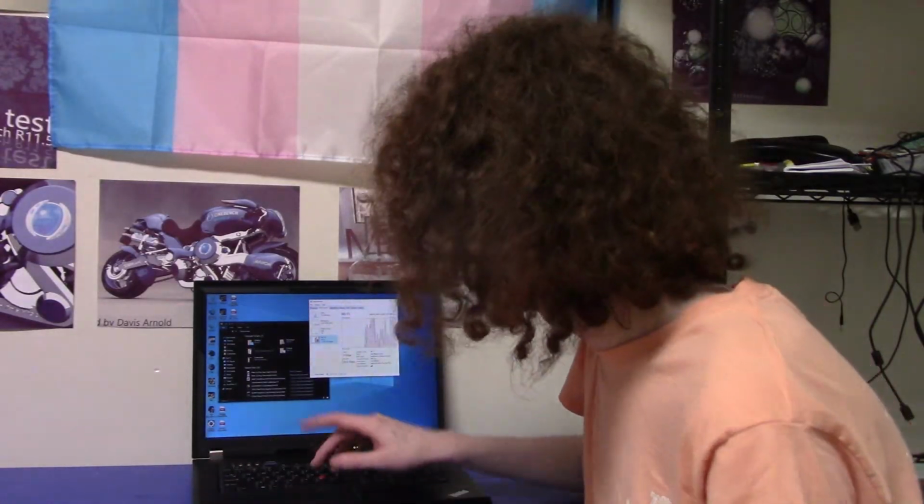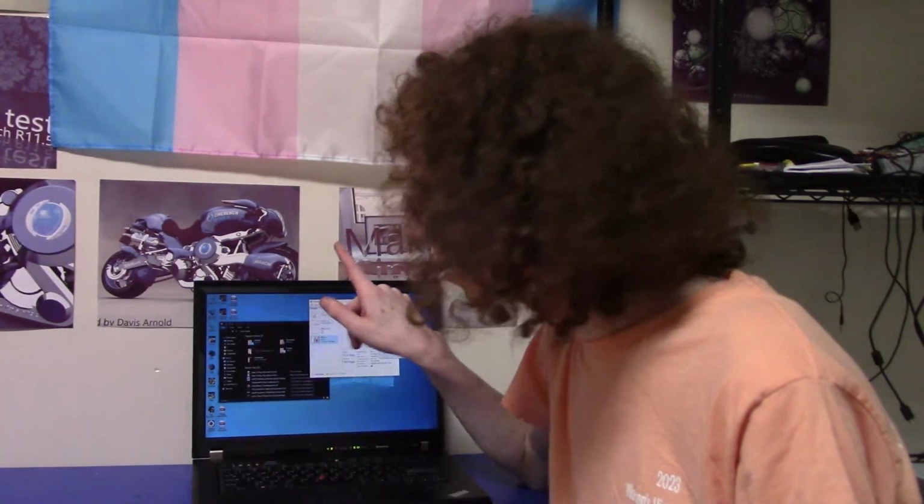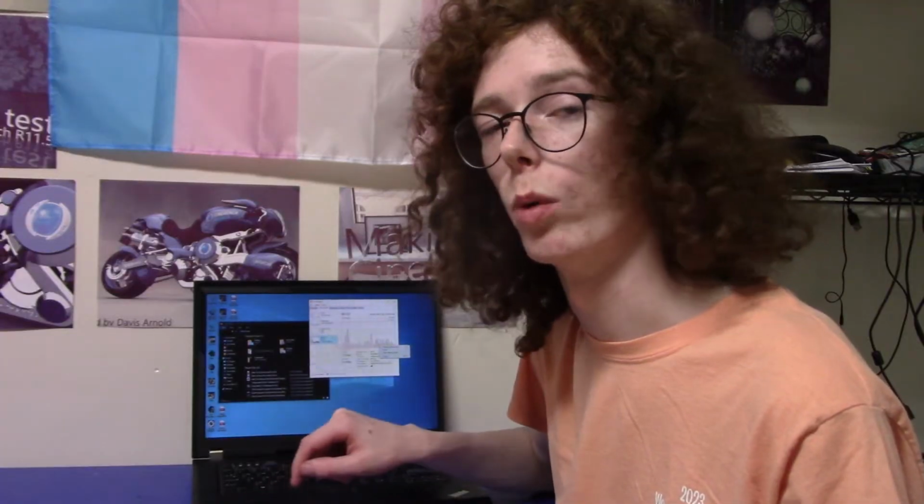so that's just a little thing to be aware of. And also, there are some ThinkPads with a BIOS whitelist for the wireless cards. I do not know if the T500 is one of those because I have no desire to upgrade the wireless card, but just be aware if you are buying a ThinkPad that that is a thing that happens. Latitudes have no BIOS whitelist, Latitudes of this era, that is, although many HP EliteBooks and ProBooks do as well.